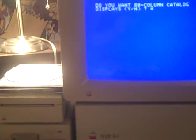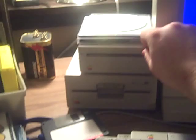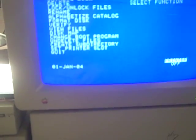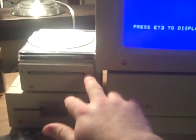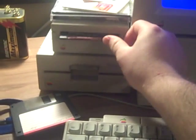It's very simple. The first thing we're going to do is erase a used 720K or 800K floppy disk. We're going to do that by booting our Apple IIGS with either Copy II Plus or System Utilities. Copy II Plus boots into this screen here. Do you want an 80-column catalog display? Yes. We're going to select the Format option, Format Disk. Select ProDOS, Slot 5, Drive 1, which is the drive that my system disk is in. And we're going to pop in just a regular old 800K floppy disk.